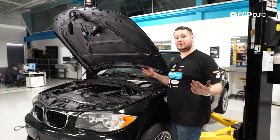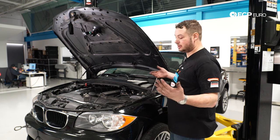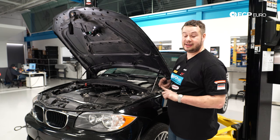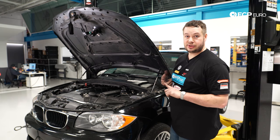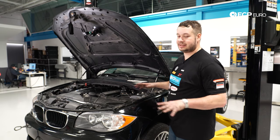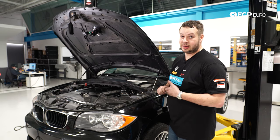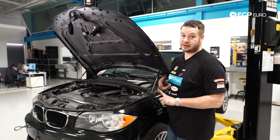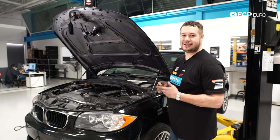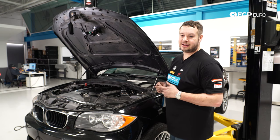We have completed installing a steering rack on my E82 128i. This will work for all rear-wheel drive E90 and E82 through E88 vehicles — so that's your 1 Series and 3 Series rear-wheel drive, with exact same part numbers and fitment. This will also work whether you have the N54 or the N52. If you like what you've seen here, please hit the like button, subscribe, and thanks for watching.